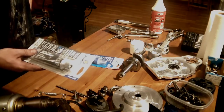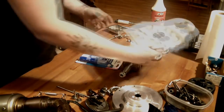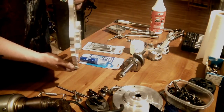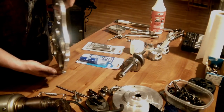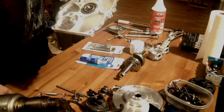This is not required, but I'm going to use it — this is an ultra-gray RTV silicone. My oil leak came from the fact that I had the chain get really tight on one flight. I didn't take into account that everything heats up and expands, so it made the chain really tight. I'm going to seal it with RTV this time around instead of using a gasket.